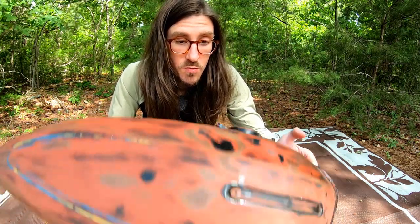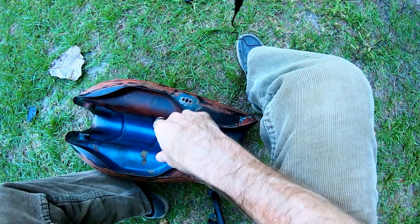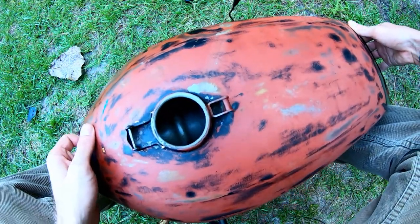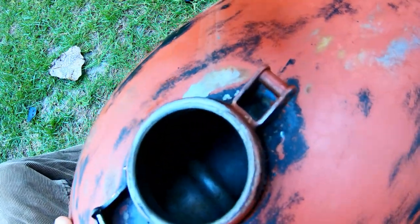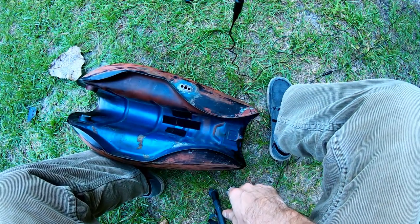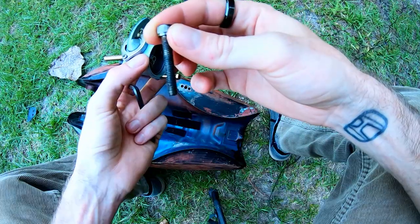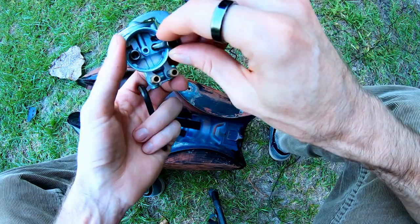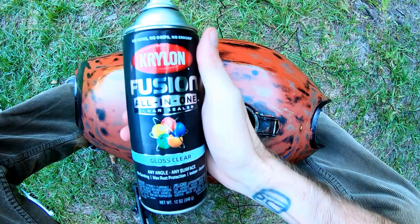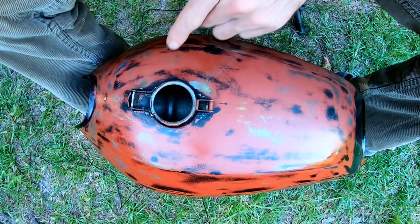This bike's going on the trip, riding on this tank — you're gonna come through for us, girl. I did the acid wash. I treated it with the oil and the gas. I don't know if you can see in there — it is spotless, it's like a brand new tank on the inside. So here's the petcock. Cut the reserve down. These bolts came out of a PA system speaker box — they're the only thing I had to fit them. Got the petcock on, the gasket material is drying, and we got some gloss clear coat. It is really clean in there.